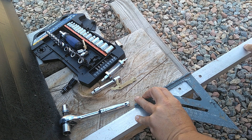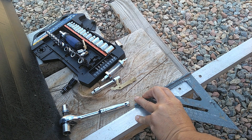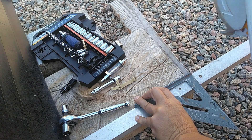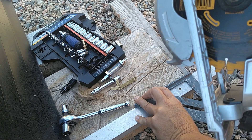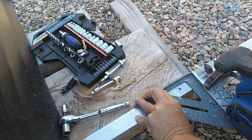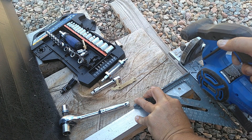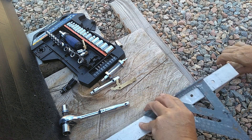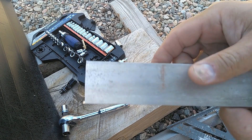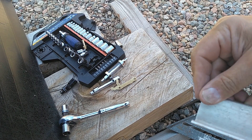I'm going to cut this bracket where the bottom of the radiator is going to sit and be bolted to. This is the thing I love about aluminum — all you need is a good woodworking saw blade with carbide teeth on it and you can cut aluminum anywhere you need to. It cuts clean. Anyway, I'm going to figure out exactly where I want to mount this, then drill some holes and put it in the machine.